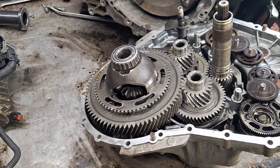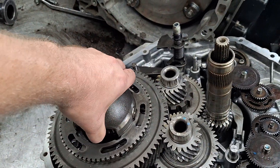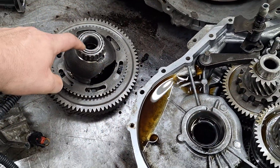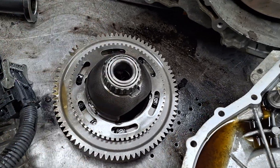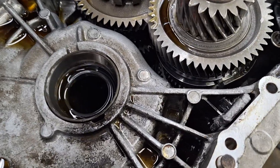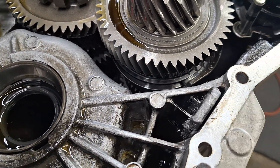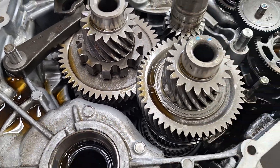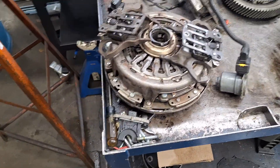Going a little further here — this is your final drive, which comes right out of here on each side. That's where your axles slide in; you can see those splines in there. With that out of the way, you get a better view of the rest of the synchronizers and forks in there. Like I said, it's just two manual transmissions in one case.